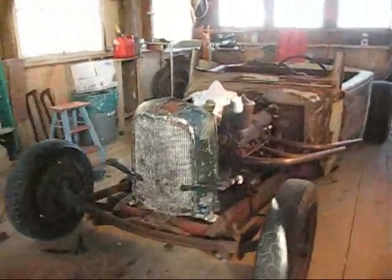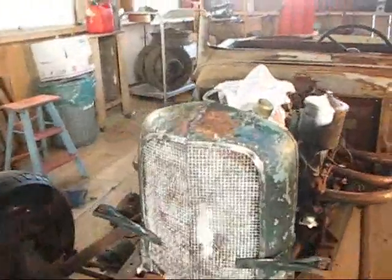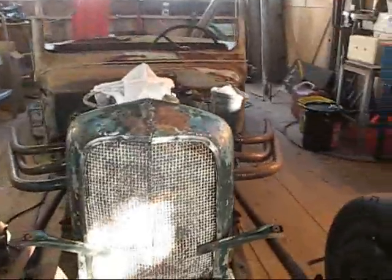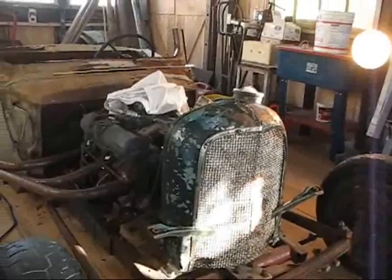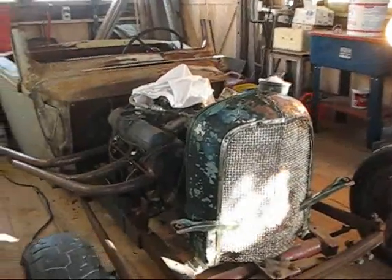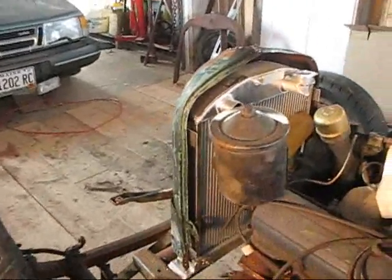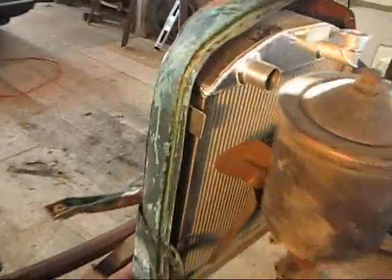This is it, kind of roughed out. I'll shoot a couple of bolts through these headlight hangers, which is exactly what it originally had, and that gives a little extra strength to the whole thing. As you can see, it fits better now — it's snugged up to the radiator, which is what I wanted. I want this thing to protect the radiator but also look half decent. It comes right up to the tabs on each side, so it should be fairly easy to drill that out and bolt it right into these little tabs on either side.